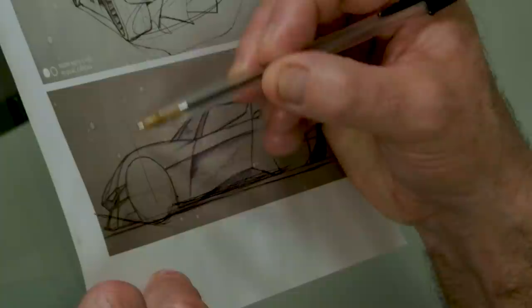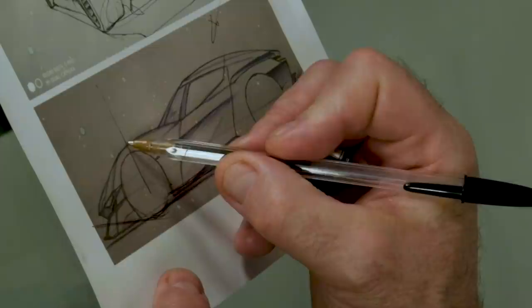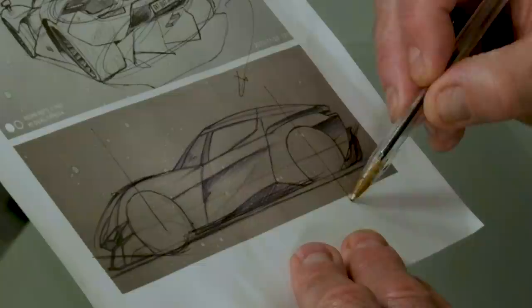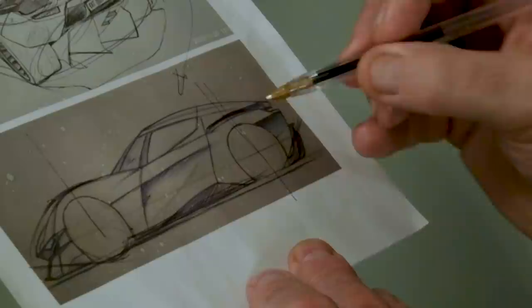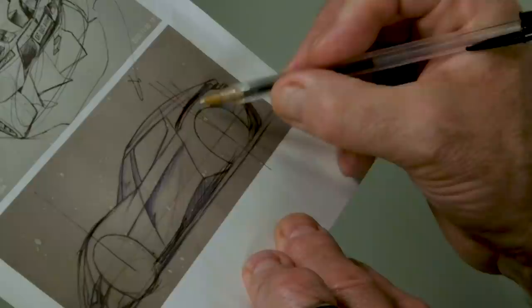I like the way you have your fender line, though it's probably slightly off. Try to put the front centerline of the fender directly over the centerline of the wheel — the highest point of the fender is typically right over the centerline of the front wheel. Same with the rear: go down the vertical centerline of the wheel and that's typically the high point of the rear fender. If you want to give a little bit of a shove feeling to the front, slightly move the high point of the rear fender forward off the centerline. Never put it behind the centerline of the wheel — that tends to make it look wrong.